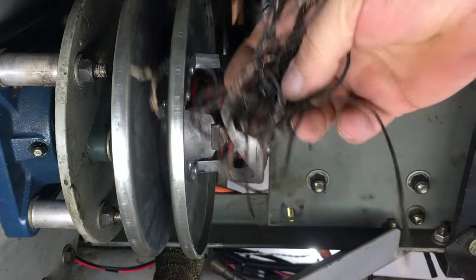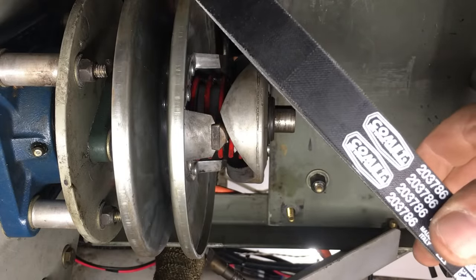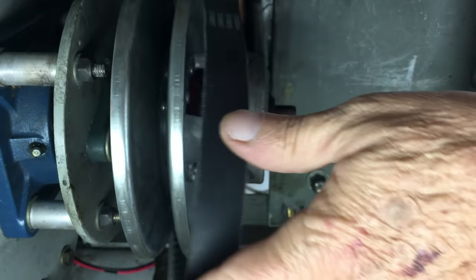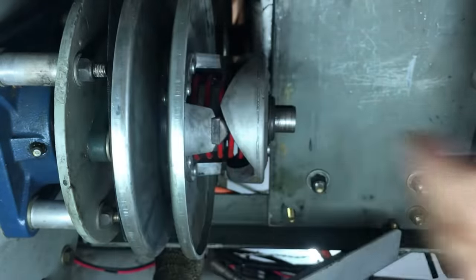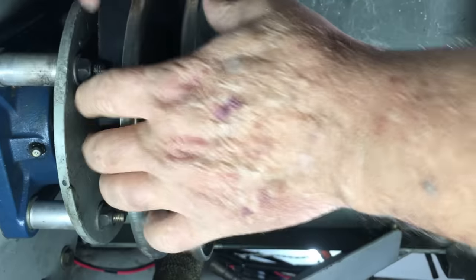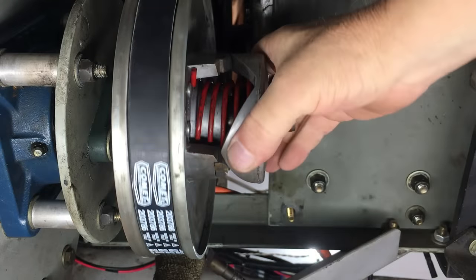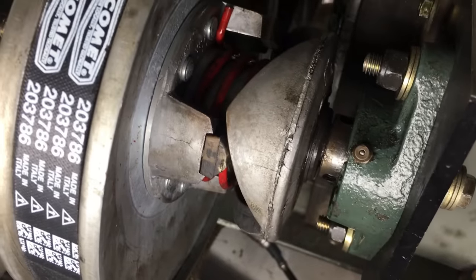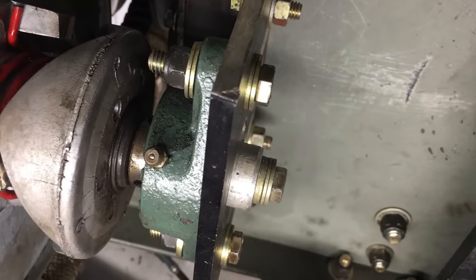The hard part of this repair was digging the remains of the old belt out of the pulley. That's all done, and now we can slip the new belt in. Normally there's a support bearing at the end of this shaft, and that makes belt changes impossible to do on the side of the road. However, there's a way to slip two belts in this limited space — one would be the drive belt, and the second a spare, zip-tied out of the way for quick install on failure. Unfortunately the transmission on this Renault leaks a bit of gear oil, so any spare belt tucked in here would be coated with oil. So it was a good plan, but we're probably better off not putting an extra belt up in here. Now with the belt and shaft support bearing installed, we're ready to take the car back to the test area.